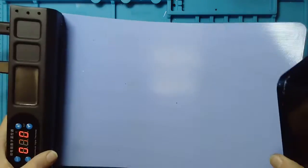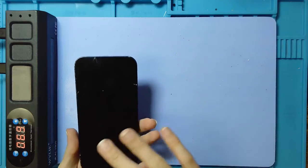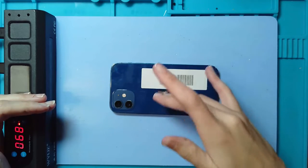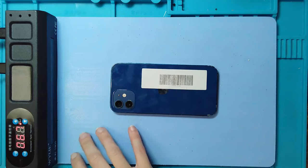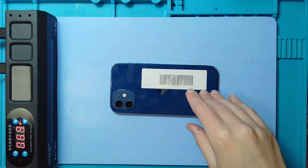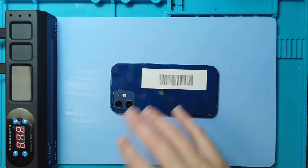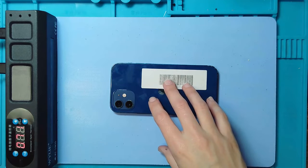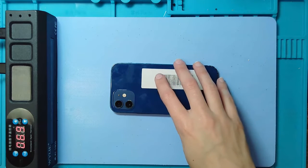I have a heat mat here. You can also use a heat gun — you may have to work at it longer and continue to reintroduce heat. Just go around the outside edge and heat it until it's nice and warm to the touch. I have it set to 70 degrees Celsius. I like to stay between 65 and 70, because if you exceed 80 degrees Celsius, or have it exposed to heat longer than 10 minutes, you can expect issues with your battery, motherboard, or other small components. 80 degrees Celsius converts to about 176 degrees Fahrenheit. If this device had never been opened before, I would leave it for the full 10 minutes because the adhesive is very strong.